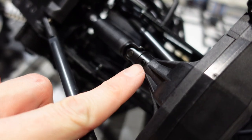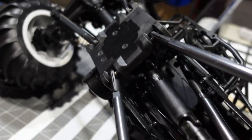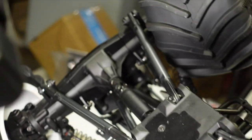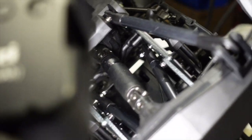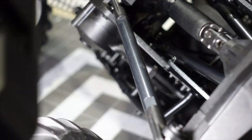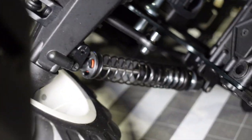One of the other things people have been reporting is issues with the nuts and the drivetrain. Keep an eye on this joint here to make sure it's staying in place, as well as a couple of these nuts. There's a nut on the inside that you want to keep an eye on — make sure it's not backing out. Same on this side, on these four links. This is a four-link suspension design — just keep an eye on those components to make sure everything's tight after running.